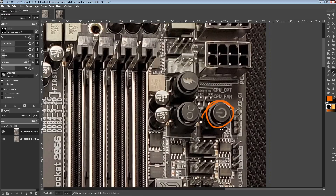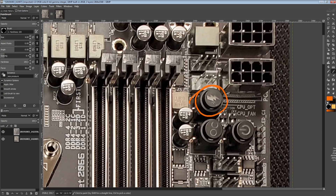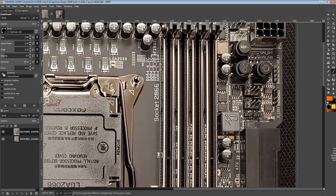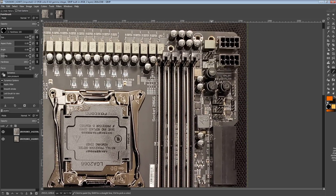Up here we have a power button, and then we have this OC button — we do not press that because it just preloads an automatic overclock profile, which tends to suck. We also have this OC ignition button. Gigabyte talks about using it for priming water cooling loops, but I'm not sure how — high-power water cooling pumps don't plug into motherboard fan headers, so it's not really useful for that.